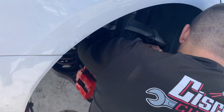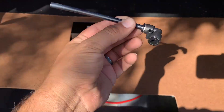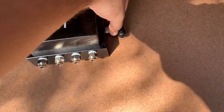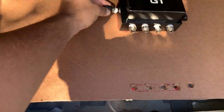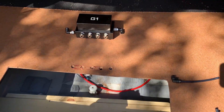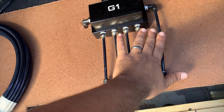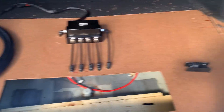While they're working on the back, I'm doing the lines that go into the trunk well. I'm using these elbows with the holes that we've already pre-made, connecting everything across and putting a 90-degree elbow here to shoot down into the wheel well, and another one on this side — that's going to be the exhaust. The exhaust runs down into the floor. All the lines are ready for the airbags; this is the intake for the air tank. We're done back here.